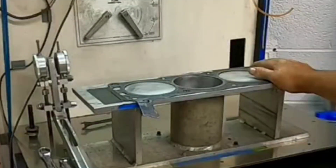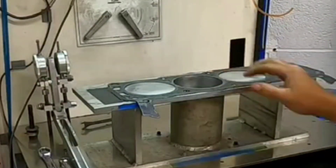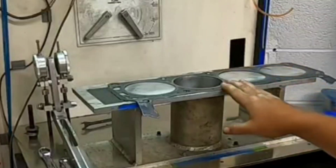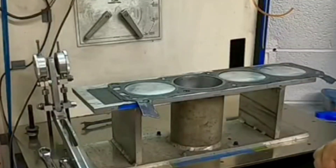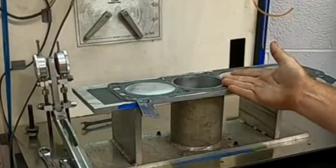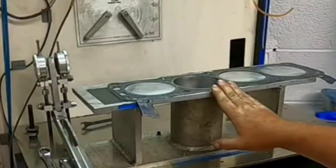One of the things you've got to do when flowing cylinder heads is pay attention to the fixture you're using to bolt the head on. A lot of times companies will quote high CFM numbers, and that could be due to using a bore that's bigger, which unshrouds the cylinder head and flows more air. So if you're using a 4.030 bore, you need to use a 4.030 fixture — that way you know you're getting the right numbers.